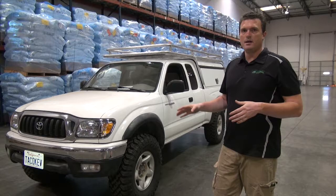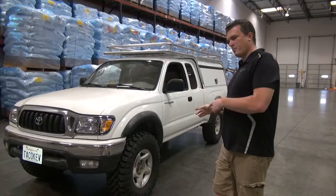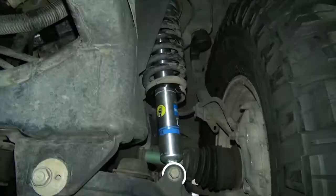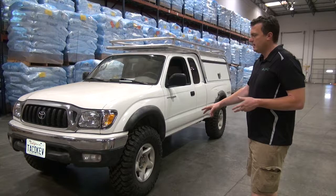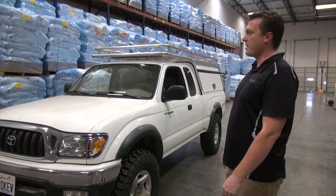If not, I think there are adjustable upper control arms I can get to set the alignment so it clears the frame correctly. I went ahead and upgraded to Bilstein shocks on a 1.5-inch riser — it's about 1.33 inches to level the vehicle out — but I plan on doing a full air ride suspension. You can probably notice the nice silver aluminum roof rack I built for the vehicle.